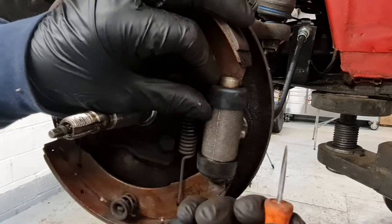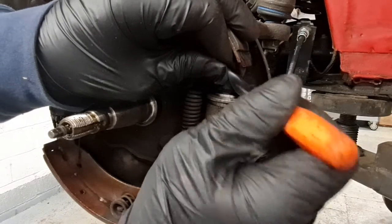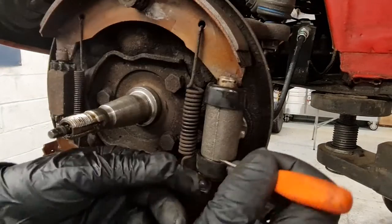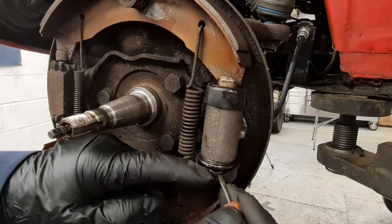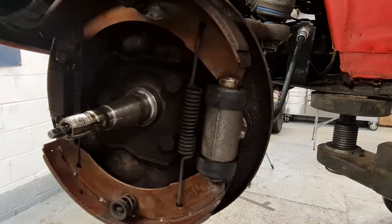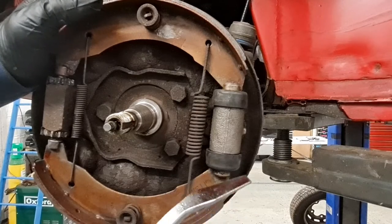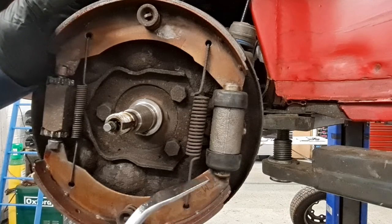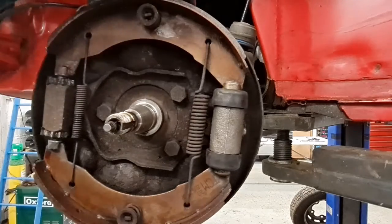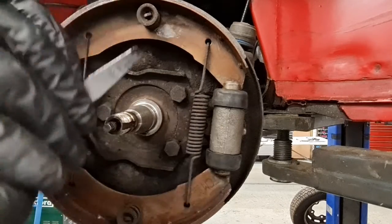Next I'm going to check the wheel cylinder. I've got a small screwdriver and I'm just going to peel back the rubber dust boot and make sure it's dry in here — we haven't got any brake fluid leaking out between the piston and the body. I'll check the other side too. It's nice and dry in there. We haven't got any splits on our boots at all, so they're in good condition. Next I'm going to make sure that our wheel cylinder moves. I've got a prop fitted between the seat and the brake pedal at about half travel, which has expanded the wheel cylinder. I can check that both sides of the wheel cylinder move by using the lever bar gently on the brake shoes. Both sides are moving, so we've got no seizure there.